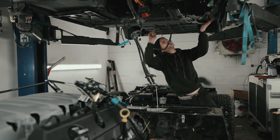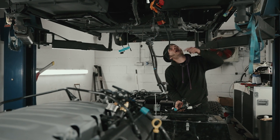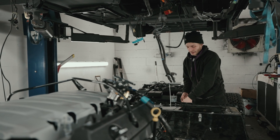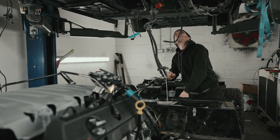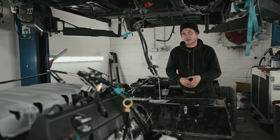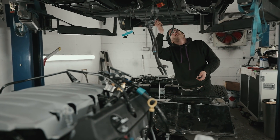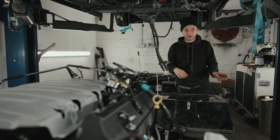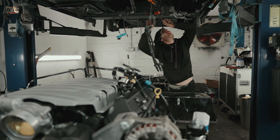Then I just need to prep this box — I'm never going to be able to get all this through that hole, and even if I could, it's not quite big enough to accommodate the area of the wires going in. So I need to enlarge it to the size of our next boot, which I know is enough for this. Then I can push all the wires through, put all the plugs back together, make sure they're secure and fastened, and put the boot in the hole.